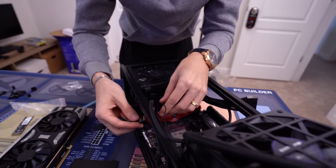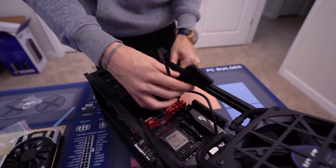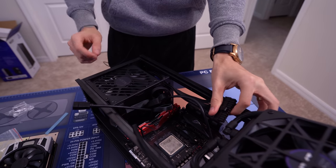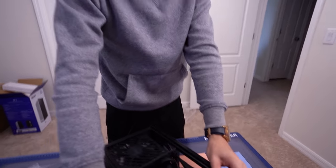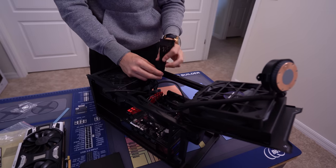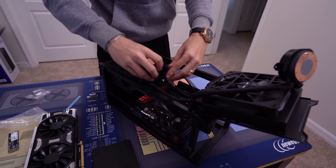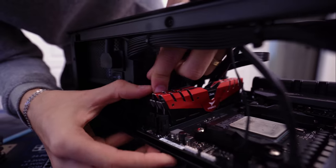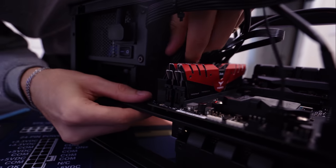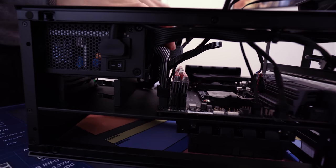Be careful — this cable is not very long. This is literally all the slack you've got. If you have a weird ITX board where the 24-pin is above the CPU socket, this cable length isn't going to work. I'm lucky enough to have it over here. I feel like I've seen some ITX boards with some super weird 24-pin placements. I got it connected, but it's awfully close.